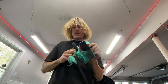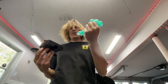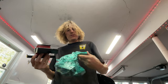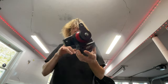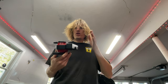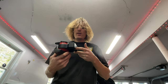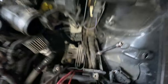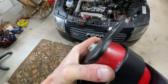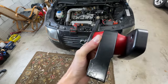I do have a tripod but I like filming kind of barbarically. Shout out to John for packaging this stuff up amazingly. This should be the transmission side — it usually goes like a washer bottle and stuff don't get me wrong, but it's literally just two bolts here and two bolts here. Since I'm gonna have the car jacked up, the transmission will be exactly where it should be. I just take the cover off, snake through the engine harness, and there's a hole for a bolt right here that goes through and stabilizes the engine mount from the top.